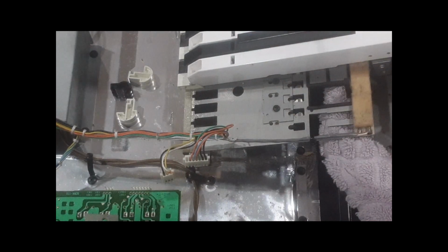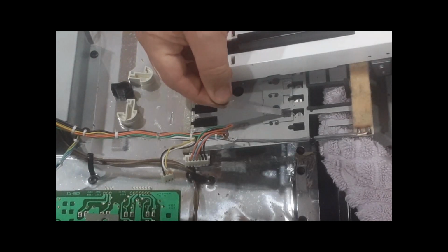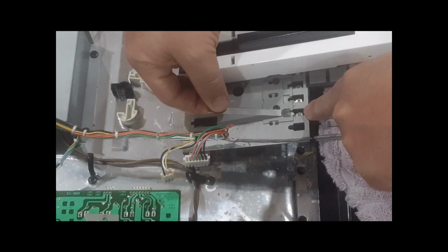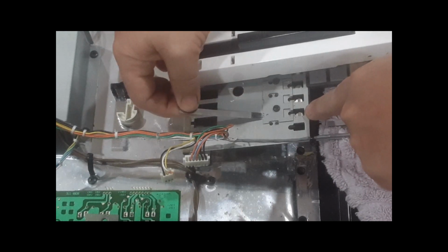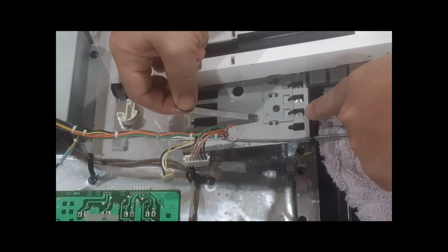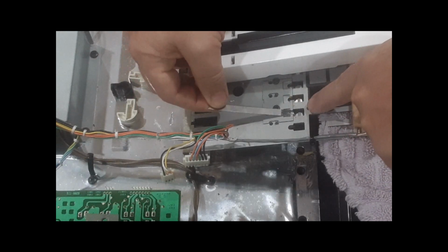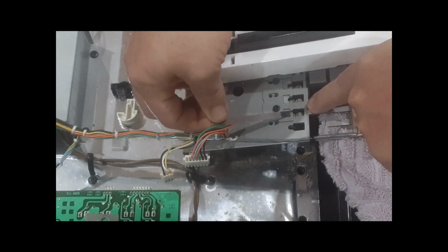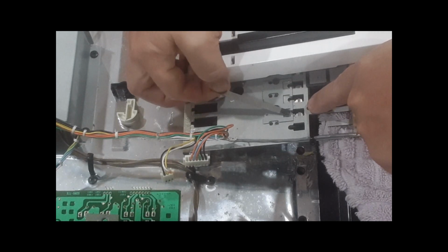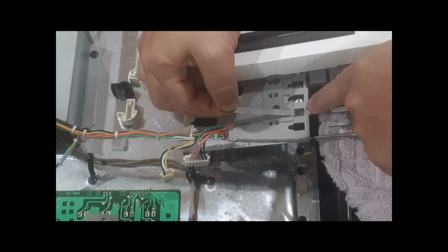So let's just talk about the springs when they go back in. The springs go right in this little slot, right next to the switch. Isn't that lovely? On the DX7, these springs are a little smaller, I think, and because of that, the hooks for the springs are way away from the switches. But here on the KX, they're right there. But look at the slot they put them in. It can get sideways. You can almost get it through there. And sometimes you'll miss this and it'll flop in there. You'll be okay that way, but just don't.